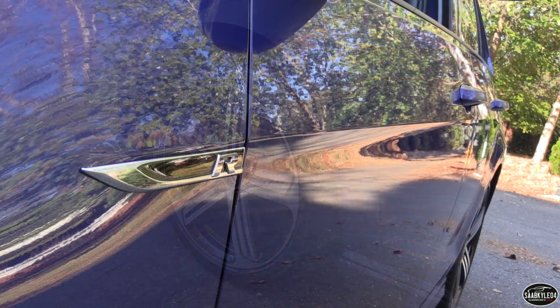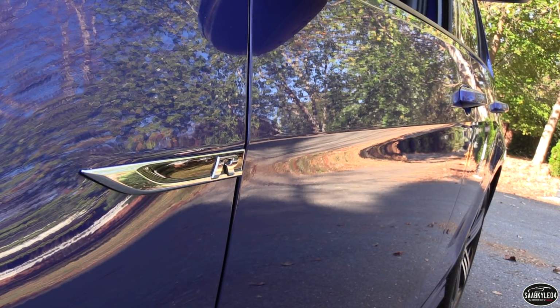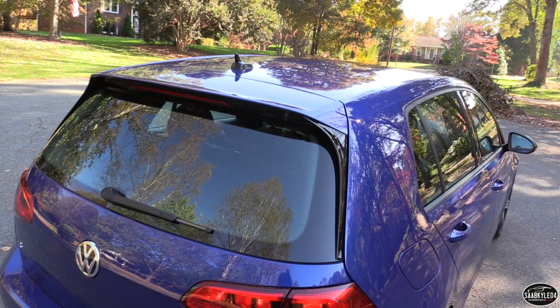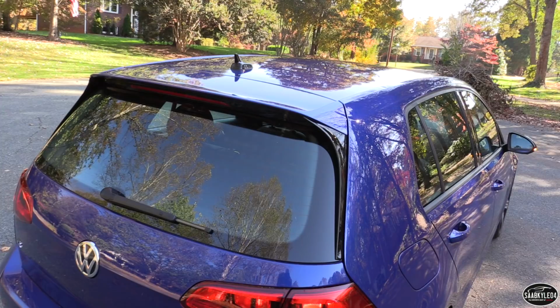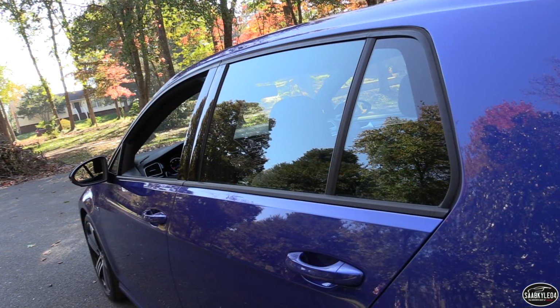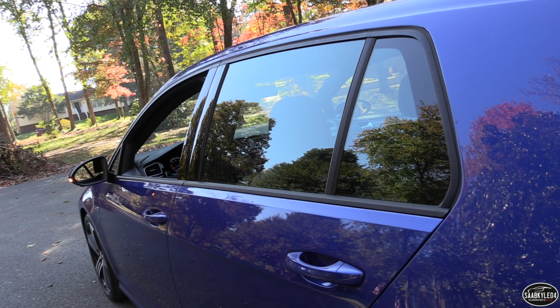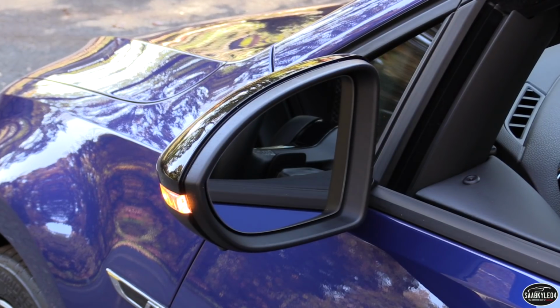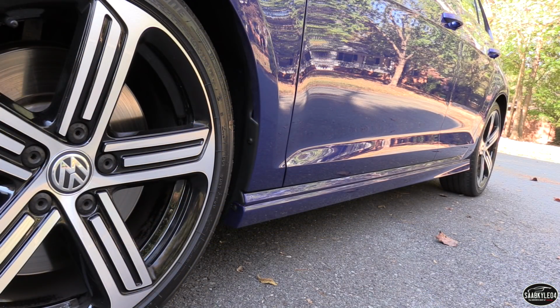It rides on VW Group's new modular transverse matrix platform, also known as MQB. By dictating a fixed relationship between the front wheel center line and pedal box, where approximately 60% of a vehicle's development costs lie, this newfound philosophy of building cars is meant to streamline vehicle production and allow for a greater range of flexibility with vehicle design.